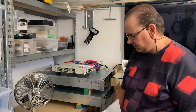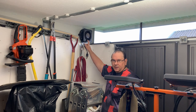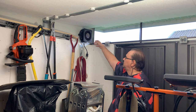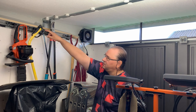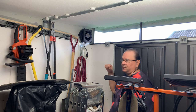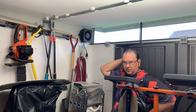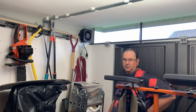I did make one improvement to this environment. I installed an extractor fan up in the corner where heat rises, to pull out all the really hot air from this area. This place has incoming air vents on top and the same on the other side. When I installed this, I can draw the temperature down closer to ambient. I've still been turning the servers off when the ambient temperature goes to 25°C or above, but for other temperatures I can continue running both servers.